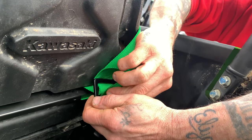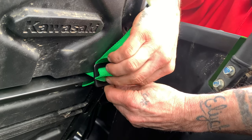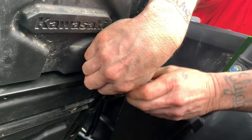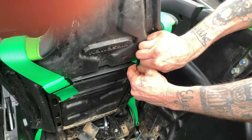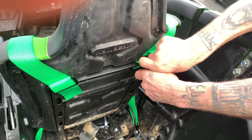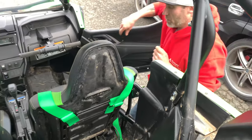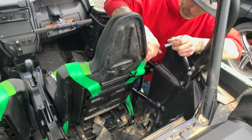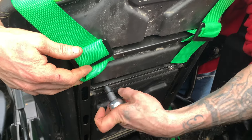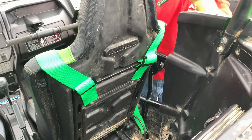Alright, there we go. The strap can be a pain, and that's exactly what it's doing. Alright, we got it now. So you pull her down there, grab your 10mm with the ratchet, and tighten your 10mm back down. Those straps are completely solid - you ain't going nowhere on those things. That's pretty much it - just do the same install on the driver's side.